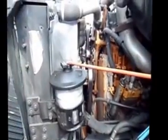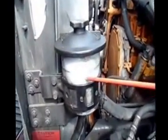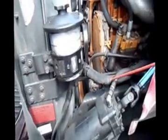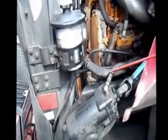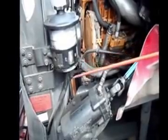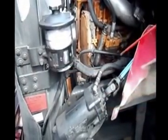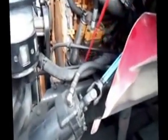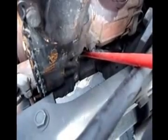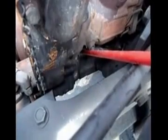We're going to check our power steering fluid, and we'll make sure it's between add and full. Check all of my power steering hoses. Make sure none of them are ripped or torn, all the connections are tight, none of them are leaking, and all the clamps are in place. And we'll follow the hose down, and we'll find my power steering pump. Make sure the power steering pump has no cracked, broken, or missing bolts. It's not cracked or broken itself, it's not leaking, and it's also gear driven.